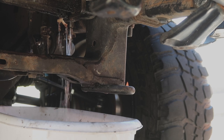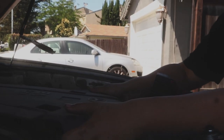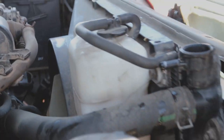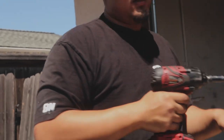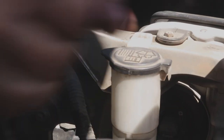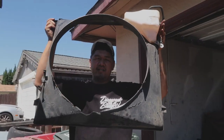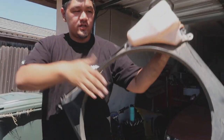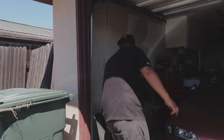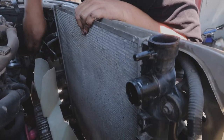So while that drains, we're gonna go ahead and set the rest of the truck up. I already took out the clips. This little impact is the best — yeah, but also the snap-on one that we have is good too; I like the snap-on one because it's lighter. The only reason I didn't need to take off the fan is because I have a body lift on this truck. Normally this lip would come around here, but I cut it because when you raise the body up it raises the shroud with it. So now I have full access to the radiator — go ahead and remove these clips over here.